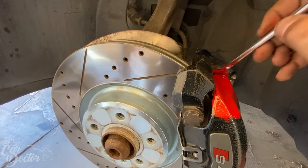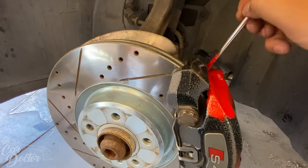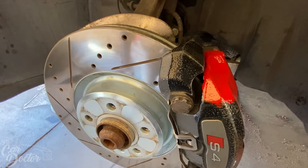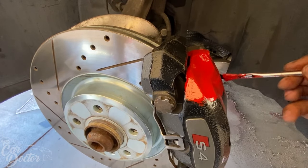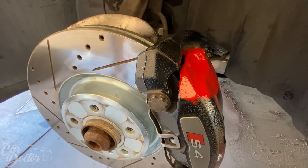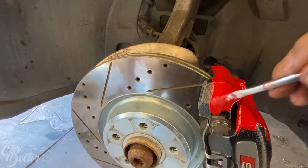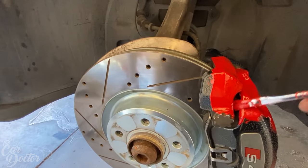The cool thing about this paint is that as it starts to dry, it self-levels really well. All these brush strokes you're seeing now are actually going to disappear — it has a self-leveling agent that smooths it out and leaves it really nice. I sanded it a little bit with 600 grit; the instructions didn't say to, but every time I paint I always sand to make sure stuff sticks. I never thought applying paint with a brush was going to be the way to do it — I'm so used to using a paint gun — but it's great for brakes on the car since you can control exactly where the paint goes with no overspray.